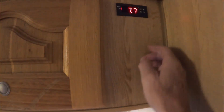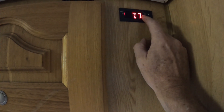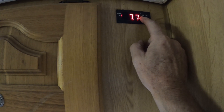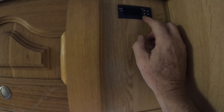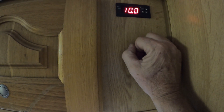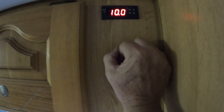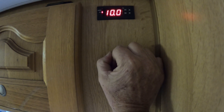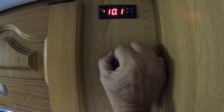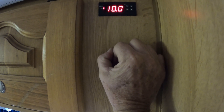With this particular controller, to turn it on and off it's just a matter of holding the reset button in and it goes off. The power to the light is still on. To turn it back on again, just hold the reset key and you'll see it's flashing — that's the timing function, so it'll count down the five minutes and then the compressor will kick in because it's well above set point.